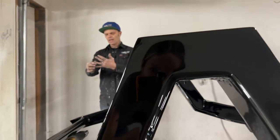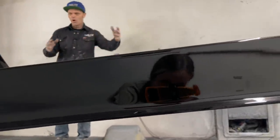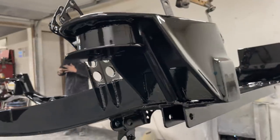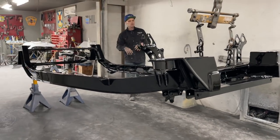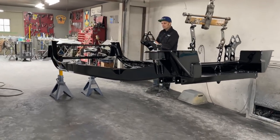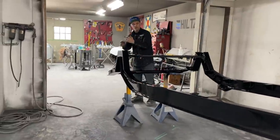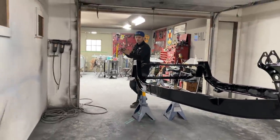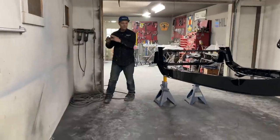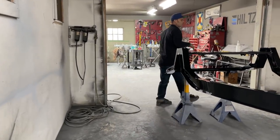We're only using four pieces of sandpaper: a 40 grit, an 80 grit, a 220 grit, and a 400 grit — that's all. On this chassis we've used 40 grit to start our body filler, 80 grit to smooth it up a little further, and one kind of primer. We do not use etch primer; we didn't use epoxy primer; we didn't use any sealers. We put enough primer on to get the job done, 220 guide-coated it, sanded it with 400, and then we painted it. You do not need a big paint gun.